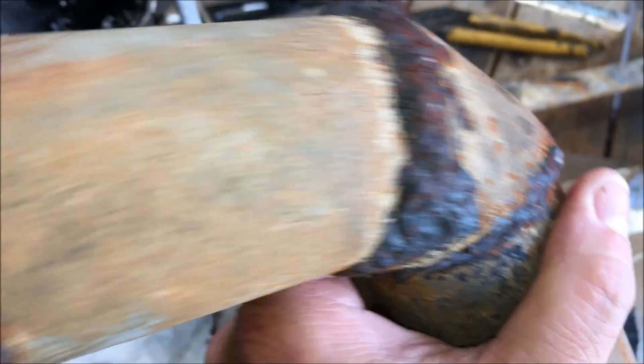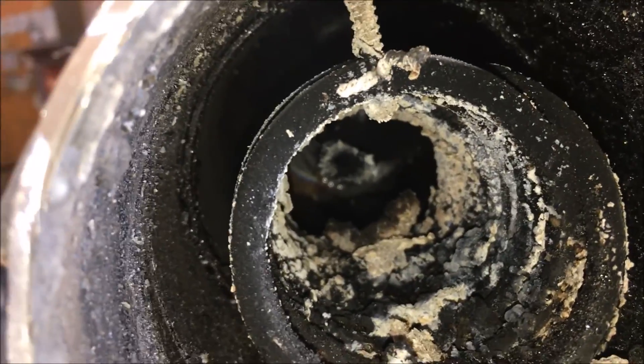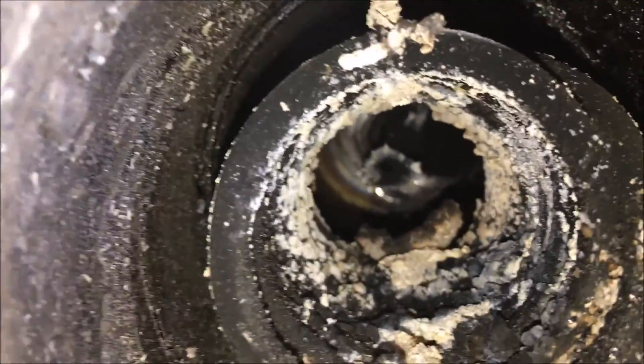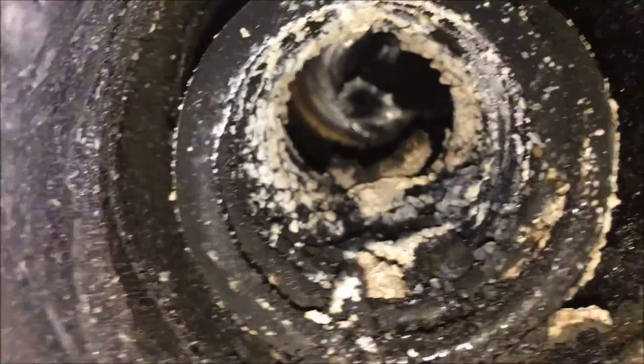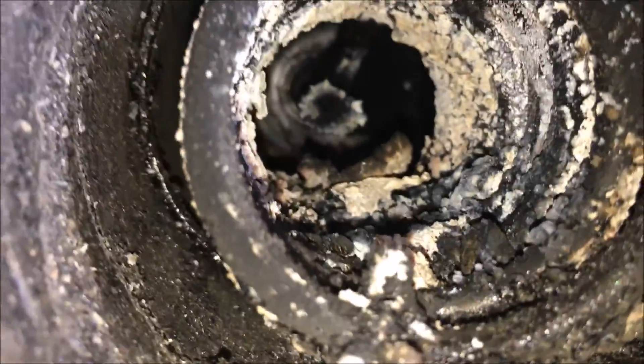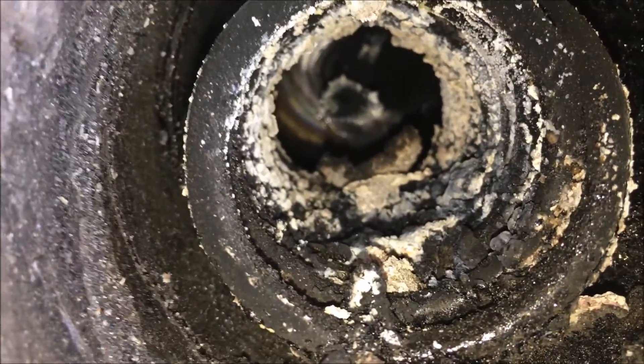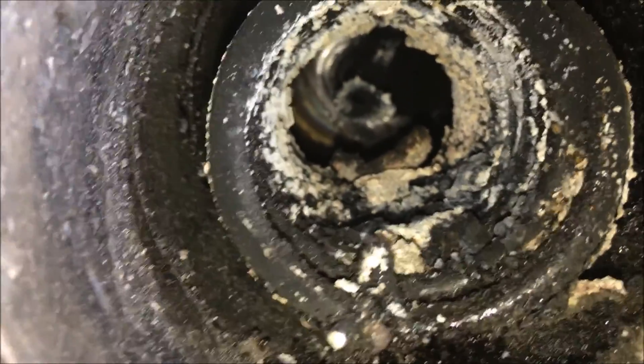You would probably need a thermocouple setup to determine the effectiveness of something like that. I'm going to try and pull that coil out of there. I've decided I don't want it in there — it seems it's varnishing up and getting clogged. The pulsations I'm getting from the injector pump are telling me this thing's clogging up. So I'm going to take it out and cut it open in a couple of spots and see how much varnishing took place on the interior walls of this copper coil.